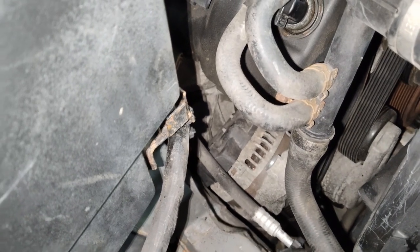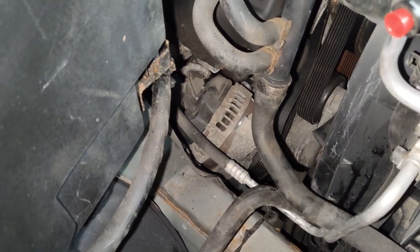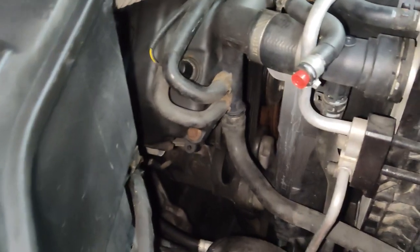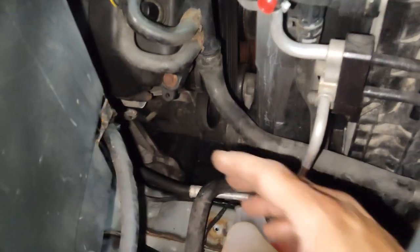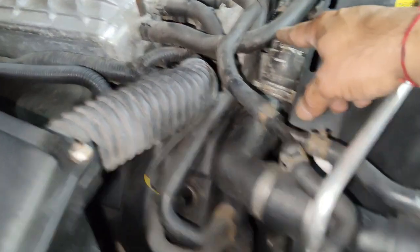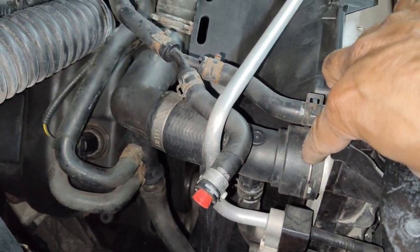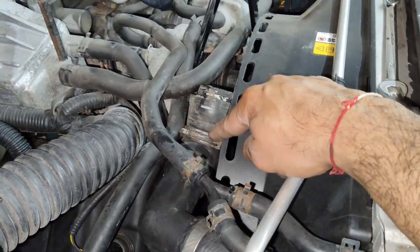At this point the alternator is loose and all connections are off — now we just have to fish it out and get the new one in. I wasn't able to squeeze the alternator straight out. Here's the old alternator — it's definitely bad, barely turns. You definitely don't need to remove the electrical box or run wires; there's plenty of room right through the headlight opening. What I did end up doing is disconnecting the upper radiator hose from the thermostat housing to pull that whole assembly up, which gave enough room to maneuver.